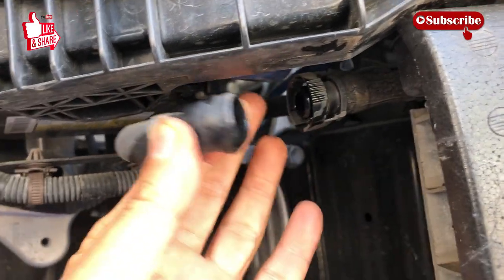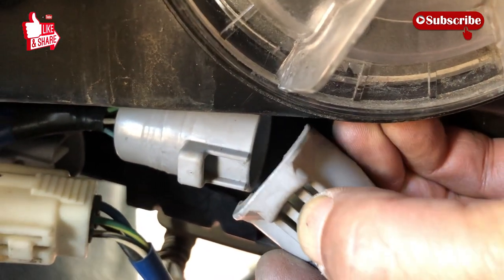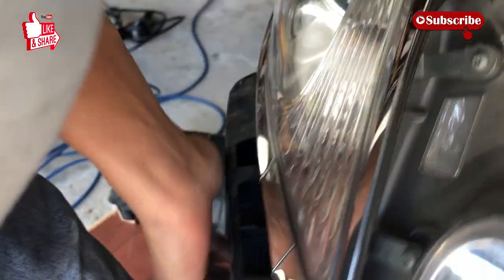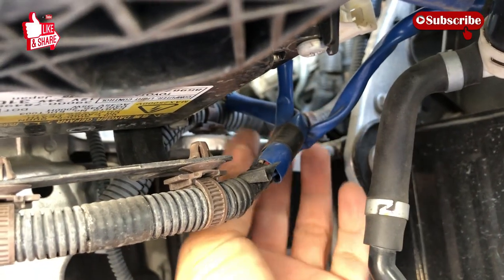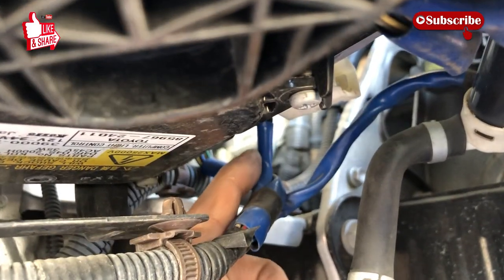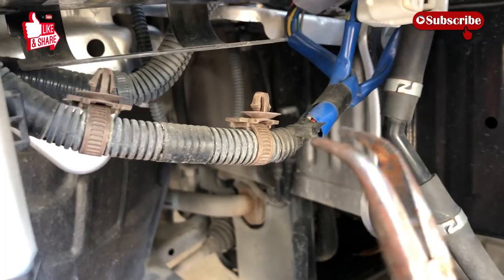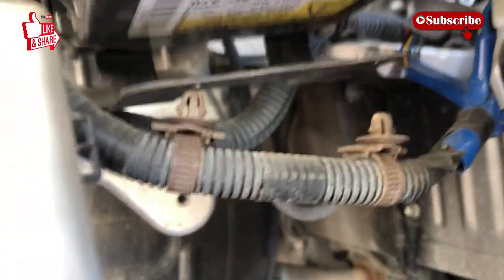You've got a couple more connectors here — push down really hard, these are very sturdy, then pull them out. Same thing for the next one. Even after all that, the headlight still isn't out. The wire going to the city light and the two wires we just disconnected are still held on with clips, so use a tool to squeeze the clip and pull it out — that came off quite easily.